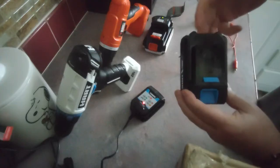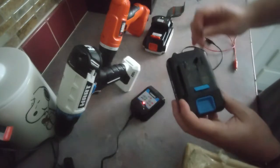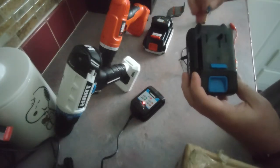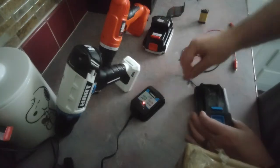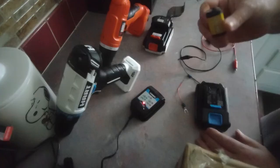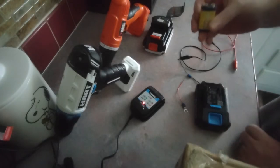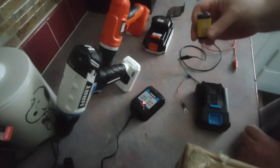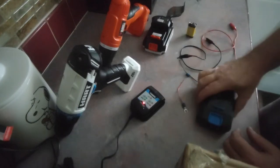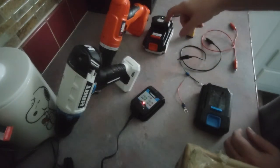Make sure you're looking at where it's labeled, and just take whatever you have and fit it flat between the contacts within these slots — negative and positive. Keep the same poles all the way through, and ultimately positive to positive, negative to negative on your 9-volt. Run that all the way through, plug it to the battery for maybe 10 to 20 seconds max, then unplug it all and plug the battery back into the charger — and it started charging just great.